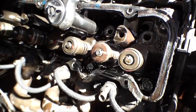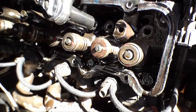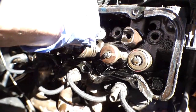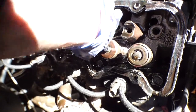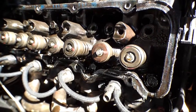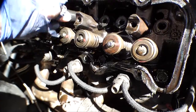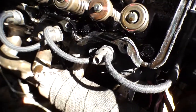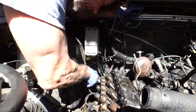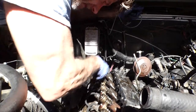Alright, well the bolts are all broken loose now. I used a 3-foot breaker bar to make it a little easier so I could do it just one-handed. And it's just so tough to lean over this engine compartment. And it looks like these all go into the water jacket, so we'll have to seal all the studs when we do that. But I'm having to switch to a 3/8-inch ratchet because I don't have the room to use my 1/2-inch drive back here in my deep sockets.